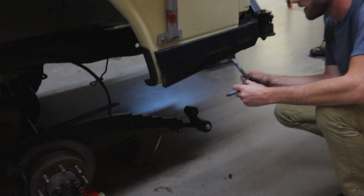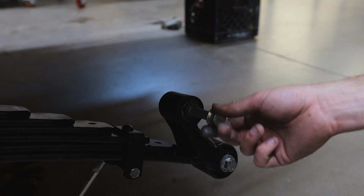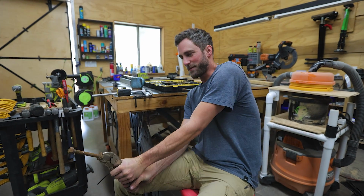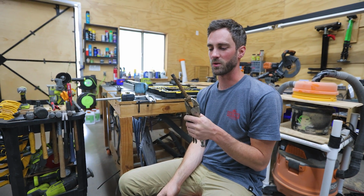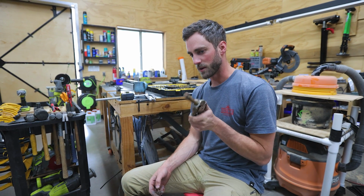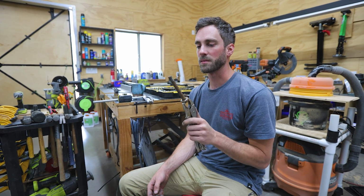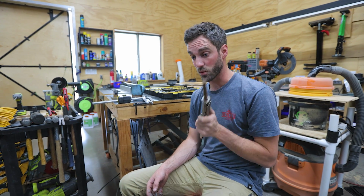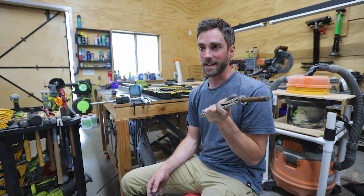The previous day's fix was fine, but we did find out something else. So what we have discovered is that these factory bolts mic out to like 13.8 millimeters or something like that. And the ones that came in those shackles that I bought from Rock Auto are like 13.6. So I'm just gonna clean these up and reuse them. And then I'm just gonna tighten those bushings down like crazy. And I think that's the issue, because I checked the bolt up front and there's like, again, a 3-second play.